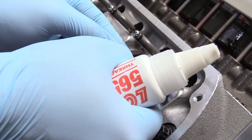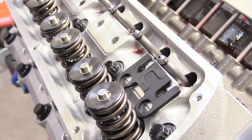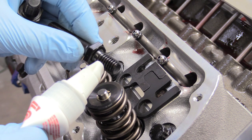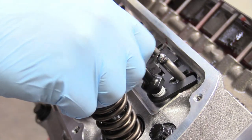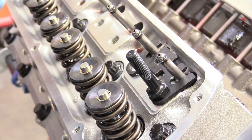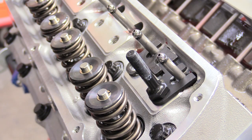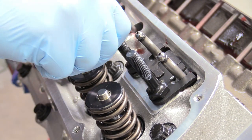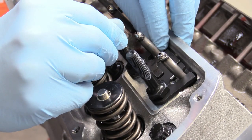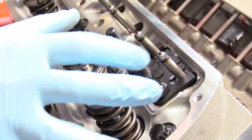With our guide plates lettering-side down, we're going to loosely put those in place for now. Then we're going to grab some Loctite thread sealer with Teflon — linked down below in the description — and apply that to our threads. We're going to install the studs, but we don't have to put them down any more than just finger tight — actually just kind of loose. You want to be able to move things around a bit, just tight enough so they won't run away on you, but loose enough so you can still adjust things.